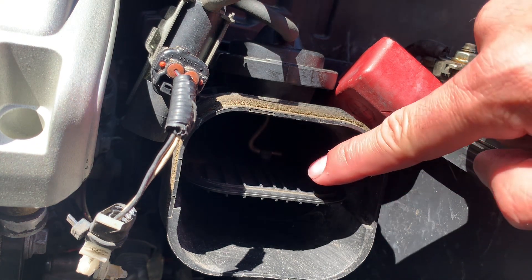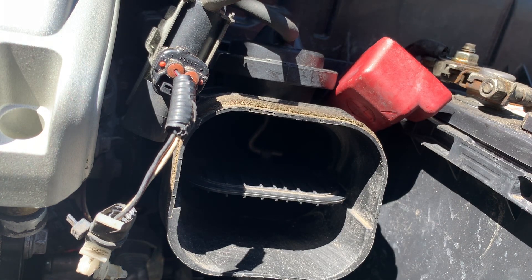As you can see, with the car off it's still open. And as I said, the chances of running out of vacuum going 6,500 RPM for two minutes straight is pretty unlikely. So this should be good. I'm going to drive it around and see how it sounds from the inside, and pay attention to see if it actually stays open all the time.